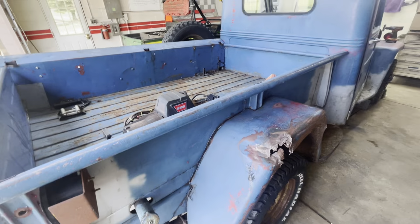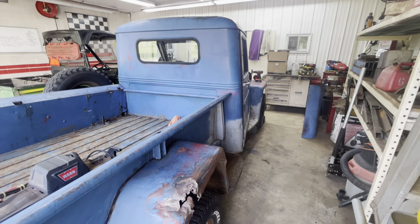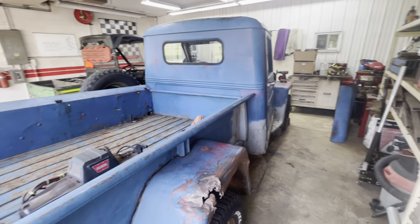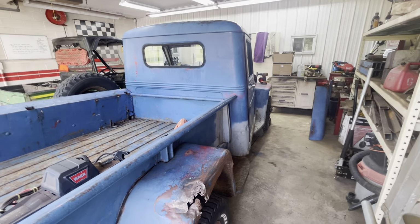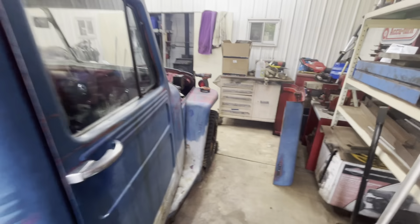As for brake lines, I'm gonna do all new brake lines, new master. But wheel cylinders and pads, I'll have to check those. I'm not gonna buy them most likely, since cylinders are expensive, and I'm not gonna spend the money unless I need to. But for sure, for trustworthiness and safety, I'm doing new lines and new master. No rotors, but pads and cylinders I'll have to check on for money aspects, they're expensive.